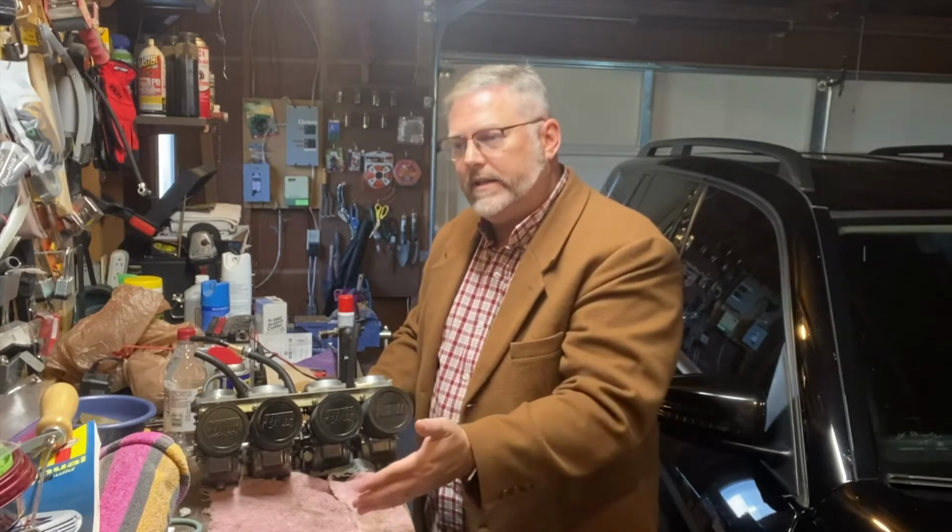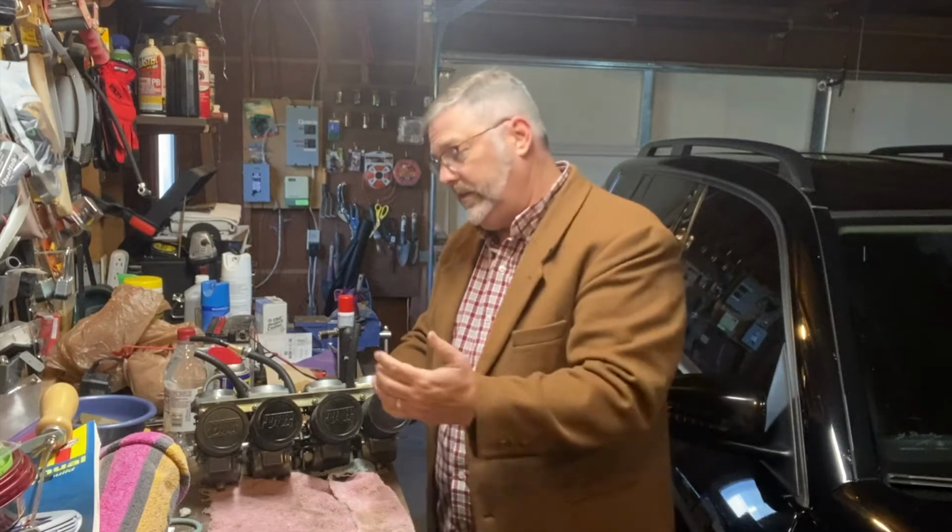The bike ran much better, but what I found out very quickly was that the air getting sucked through those carburetors when the piston pulls down has quite a bit of force to it. It basically sucked the foam right out of the pod filters and into the carburetor, which kept all the valves open and made a mess, and it didn't run right. So I kind of quit after that. I probably could have glued the foam inside the pod filters if I wanted to explore it more. But maybe someday in a project I'll create pod filters with adjustable airflow through them to see if that makes it easier than having to crack the carburetors open and rejet them.